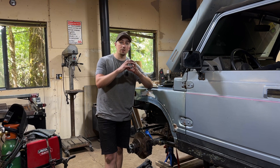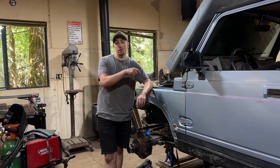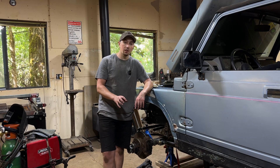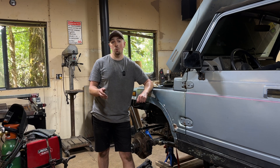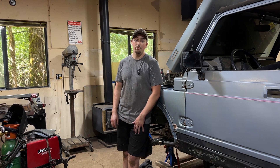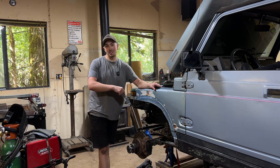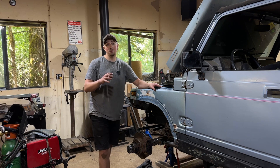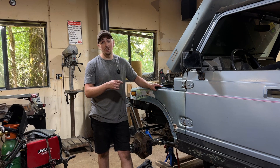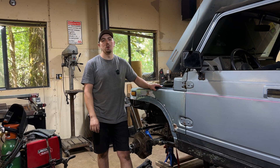The PVC pipe has about a two inch outer diameter. It doesn't need as much structure with the upper one, especially right now, and PVC will be more than enough for strength to get some interference checking and cycle the suspension to make sure it's going to work. If everything looks fine, we'll cut out some DOM and do that properly with metal. I want to see this suspension cycling before the end of the day because this has been a very productive weekend and I really want to know if I either have some big design changes or if we're looking good to keep marching forward with this front suspension.